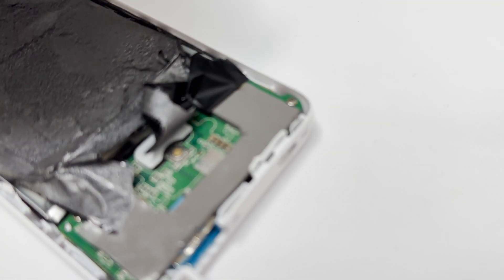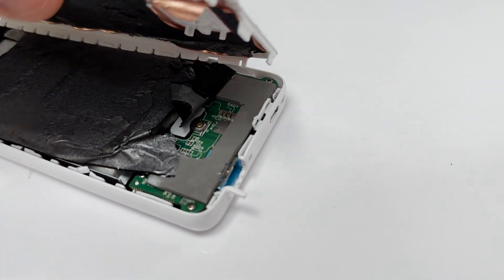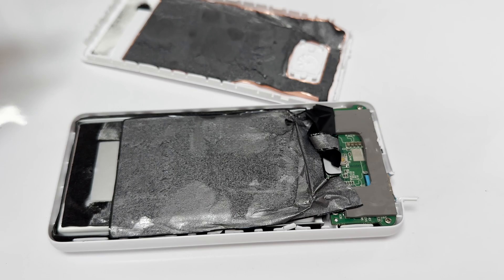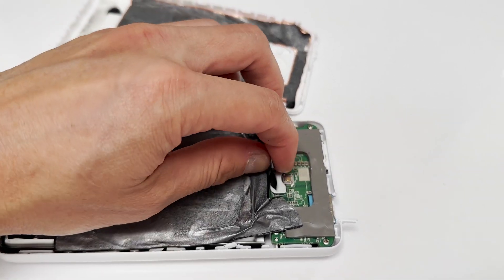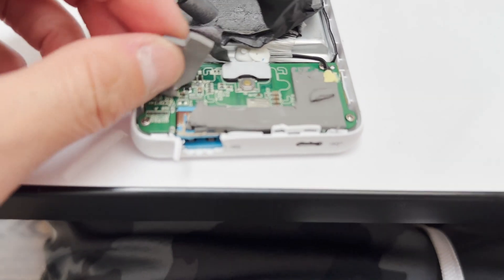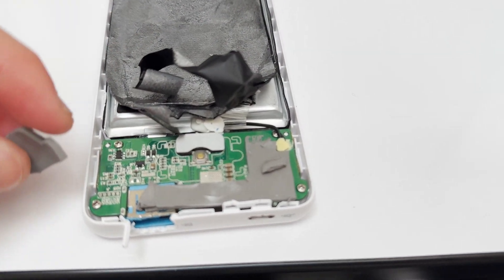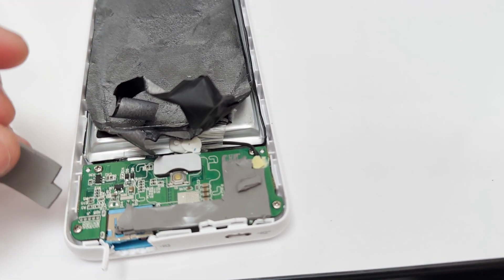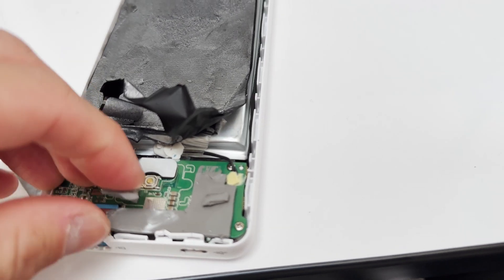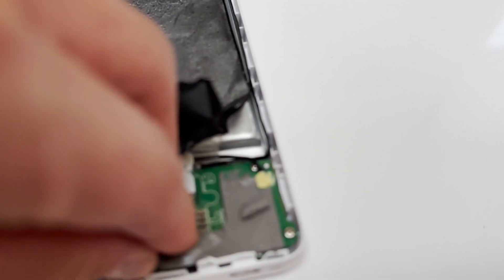You can probably pinch here, pinch here, pinch here, and push the tabs to release the tab clips. Hopefully you do a better job than I did. There's also this glue on here — maybe you could heat up the front of the pack to make it a little loose and easier when you're trying to pry it apart. This is the adhesive that's holding the case to the body.